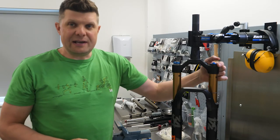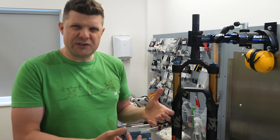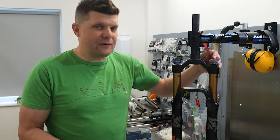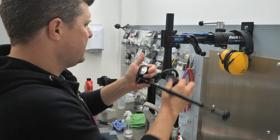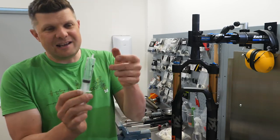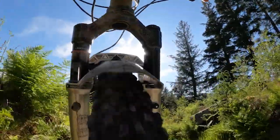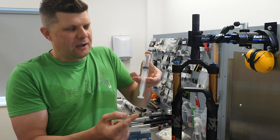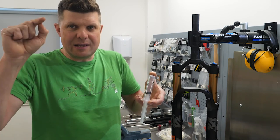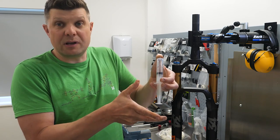On the left-hand side or non-drive side is the air side. There are some coil-sprung forks on the cheaper or most expensive models with different advantages, but I'm presuming most of you have an air-sprung fork you fill up with a shock pump. Inside it works exactly like a syringe — I've got one here to show you. If I put my thumb over the end and use my finger as a rock hitting my front wheel, the harder I press the more back pressure I feel, because as volume halves, pressure doubles. That gives us the ramp rate in the spring, meaning I need to press harder and harder to compress that air, and when I do, the spring becomes that much more reactive.